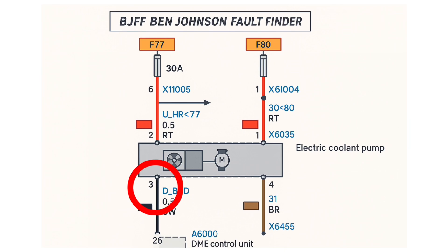When this pump loses the BSD bit serial data signal and can't communicate with the DME, it can't receive commands down the BSD — which is a little square wave signal you can scope. If it can't get that signal because the wire's gone or another unit is corrupting the bus, it will command itself to go full speed, full power. So if you hear it screaming away even when the engine's not running and the ignition is on, you've lost BSD comms — whether that means the board is faulty or you have a wiring fault.